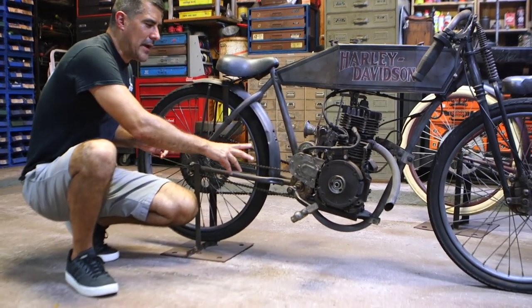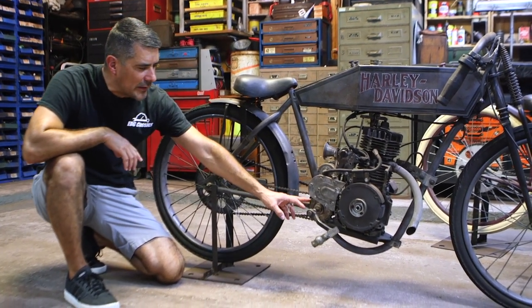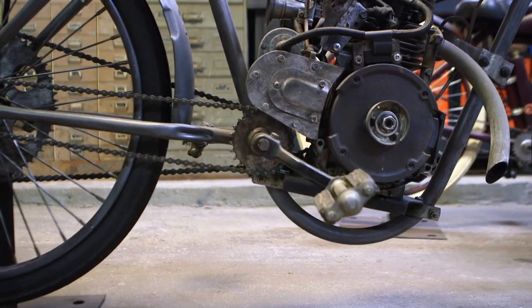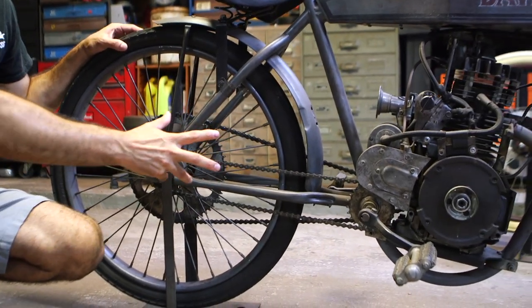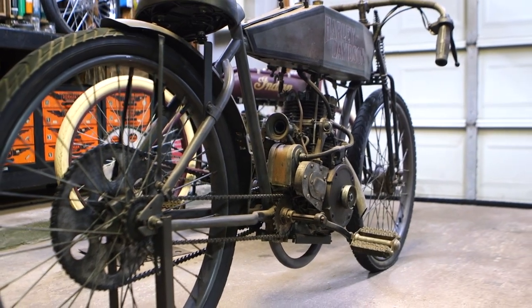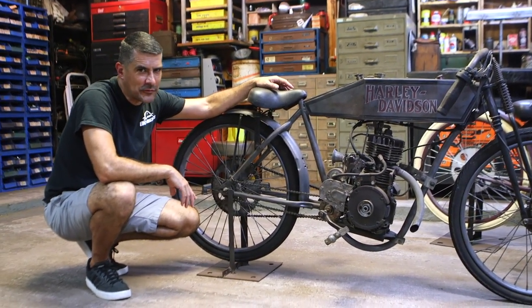First, I wanted to go over the pedal and coaster brake side. The first thing you'll notice is that we're using a different type of jackshaft on this lower bracket. On that jackshaft I've got a 24 tooth sprocket that connects to the rear wheel — the original sprocket that goes on this Worksman rear wheel. This setup allows you to still use the rear coaster brake and pedal the bike should you run out of gas, have a mechanical problem, or if somebody gives you a hard time for riding through the street — you can still pedal home.